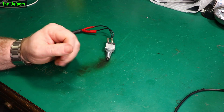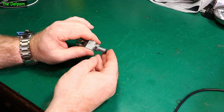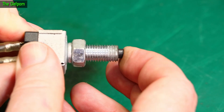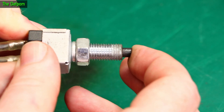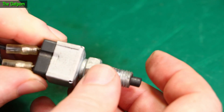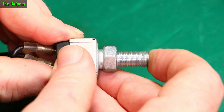That wasn't actually activating the switch. That's maybe what caused the switch to fail — maybe it wasn't activating properly, maybe it stuck on and caused it to burn out. Just now I was pushing this plunger really hard; it was sitting about there and wouldn't really move. I pushed it really hard and it popped in like that, and now it's coming right back out. It's got a point right there where it's binding. I think this switch is now freed up — I bet this now works.